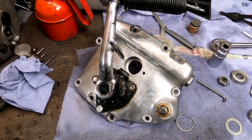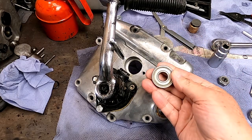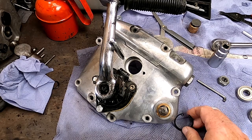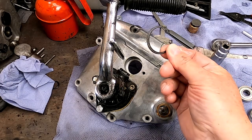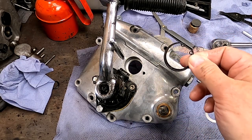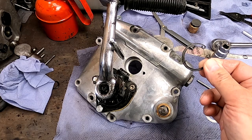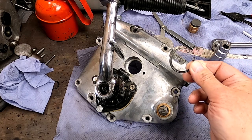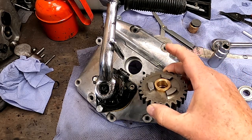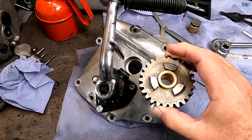So before I waste time with a little micro camera, I've bought a new bearing. I'm going to dig the shields out of this and install this, and then I've got some shims, and I'm going to shim up the bearing to make sure that there is no gap between the circlip and the bearing, and therefore the bearing is going to stay put, and that should keep the orientation and the geometry of the main shaft under control, which hopefully will mean that I don't have to indulge in all sorts of machining to get the mesh on the gear. Anyway, I'm glad I decided to think about it. I thought about it overnight. It's always a good idea to have second thoughts. Anyway, lots to do.